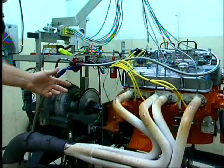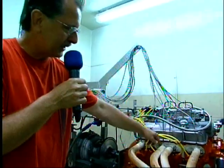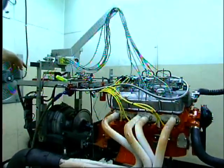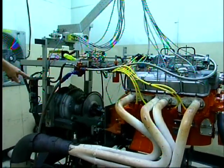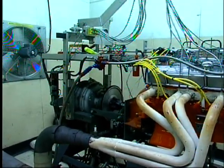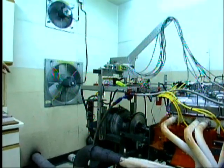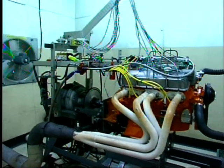You're hooked up to monitors — oil temperature, oil pressure. There's your radiator. There's your sensors that measure the fuel ratio. Ignition system simulated, flywheel — that unit there measures the torque and it spits it to the computer in the other room. Of course exhaust goes out. We got two fans to keep everything cool. Fuel pumps with different types of fuel in it.